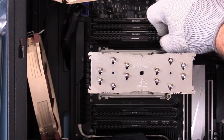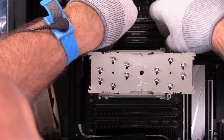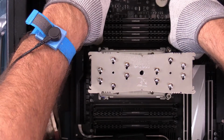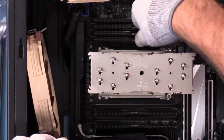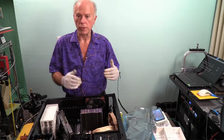Anyway, final slot, closest. Put the heel in first on the left. Make sure we're going straight in. Make sure we're lined up. Label's correct. Click in the left. Click in the right. And it clicked like it's supposed to. Okay. All 4 should be in, secure, and registered. Fantastic. Now we'll get this side closest to me.